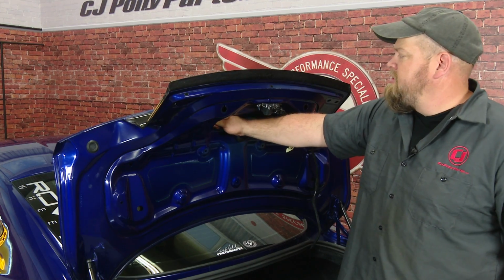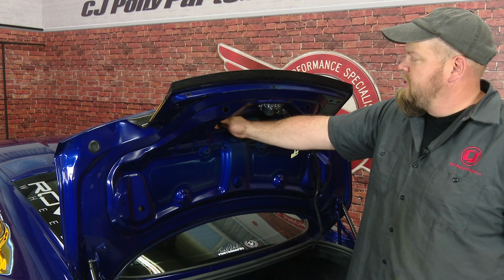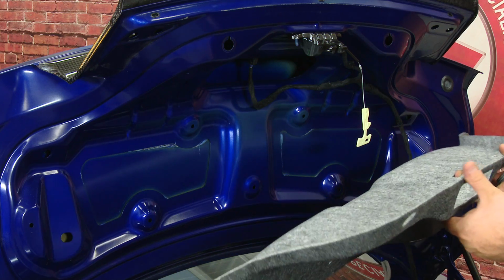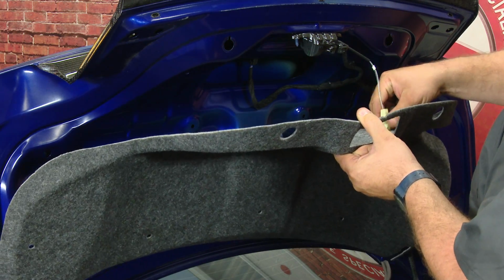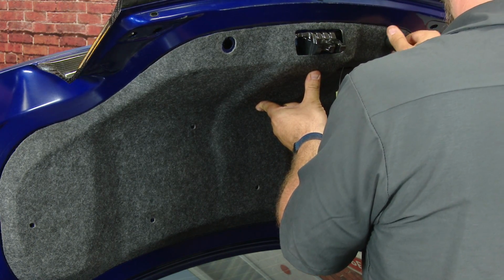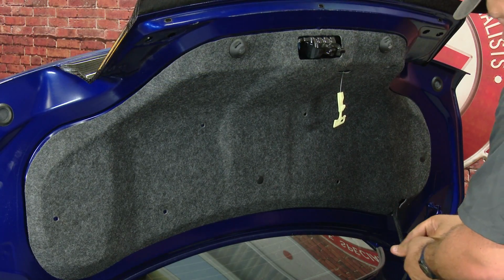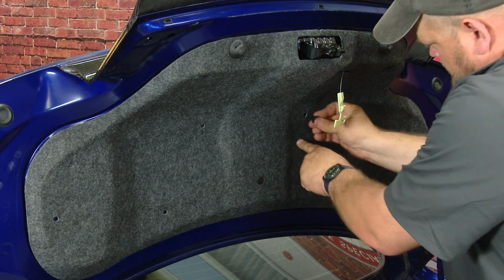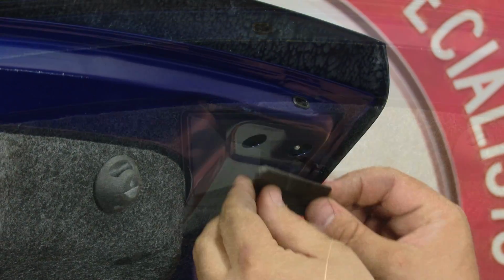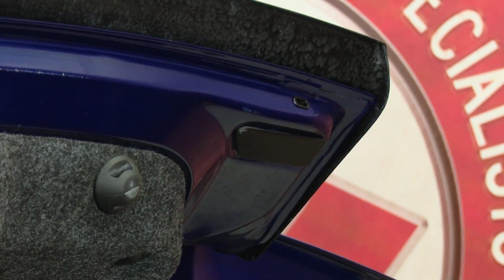Use a small wrench, get them in here. Like I said, just, again, get them snug. You don't want to crank on them too much because they're just studs sticking out. Basically hand tight, maybe a quarter to half turn past that is going to be tight enough. Okay, I'm going to reinstall the trunk liner. Reinstall the latch cover, and lastly install the factory covers over these bolts, and your installation is finished.